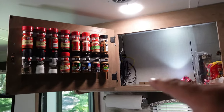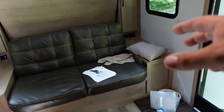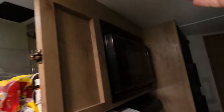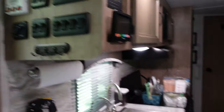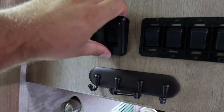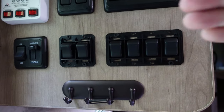Let's take all the covers off so you can see how I actually wired the master switch. I did mention in my solar power video that I wired everything up into the ceiling, down next to the fridge, under the actual basement, into the basement for all the battery work. I cut access panels, patch them up, and remove the microwave to access more. Now I'm going to remove the switch cover — the cover just pops off with a flathead screwdriver. I'll remove these two screws and pull them out a bit since there's a little extra wire.